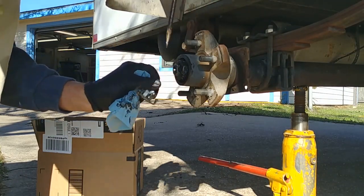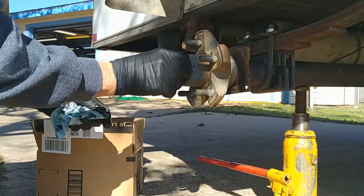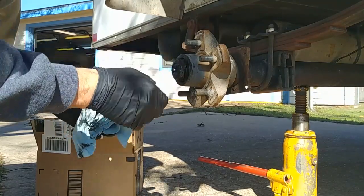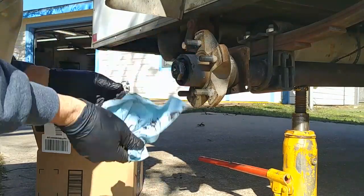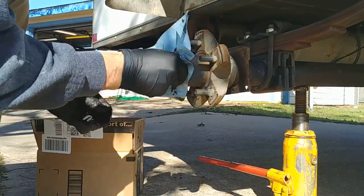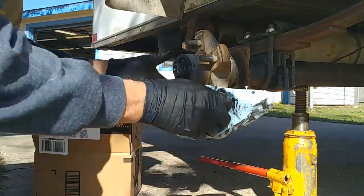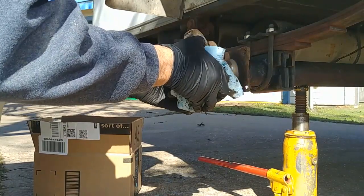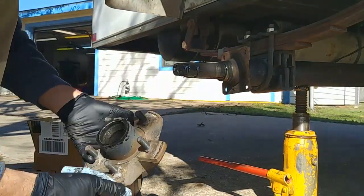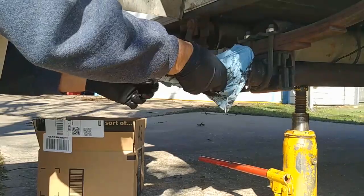The retainer just pops on and off. Now there's a nut to take off — usually they're hand tight, but if they're wrench tight they're probably too tight and that's going to lead to bearing failure eventually. I'll get into that when I reinstall the hub. The hub comes off revealing the bearing, washer, inner bearing, inner seal, and we're left with a greasy axle stub.